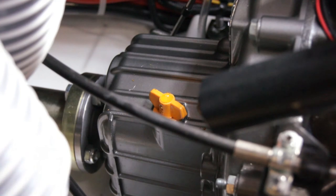The gearbox is located at the back of the engine, and the dipstick for that is located on the top. You shouldn't have to deal with that anyway, but if you do need to check the gearbox for any reason, unscrew the dipstick and give it a wipe with a tissue. Just sit it on top of the gearbox, then take it out and check the line. If it's within parameters it should be fine.